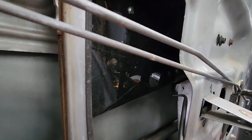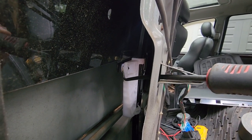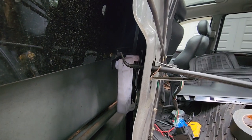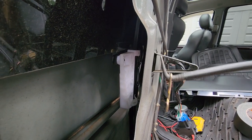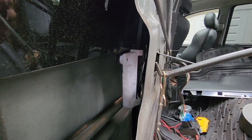Here's a better angle for you. These little clips — just gonna want to pop them out. There's one. If they fall into the door, that's fine, you don't need to retrieve them. We just want to get this window up. Luckily mine stayed on my pick. There's another one up here on this side. That one went into the door — no biggie, don't need it right now.